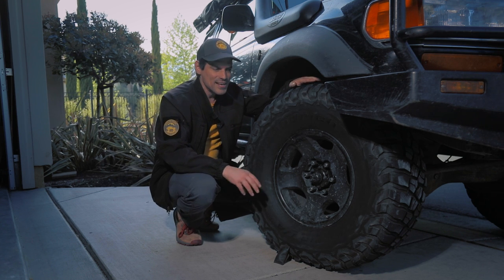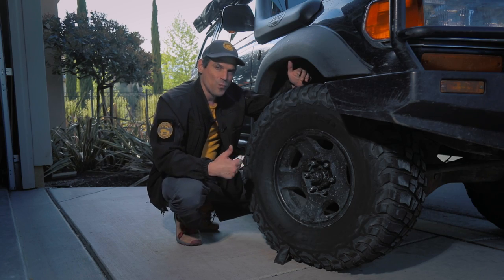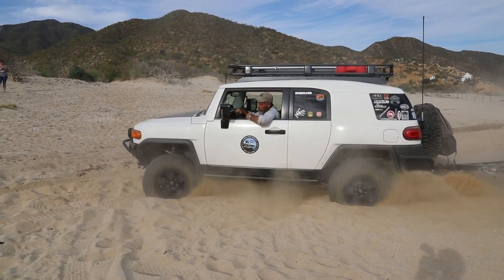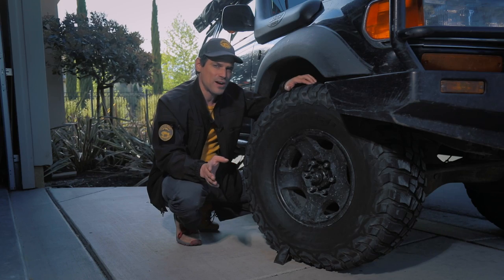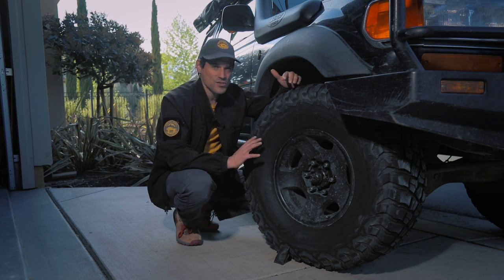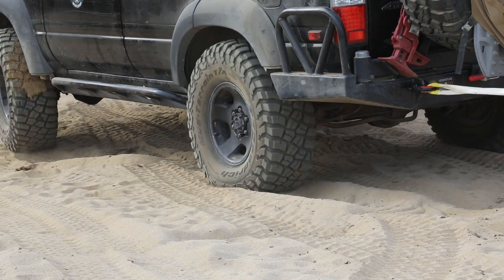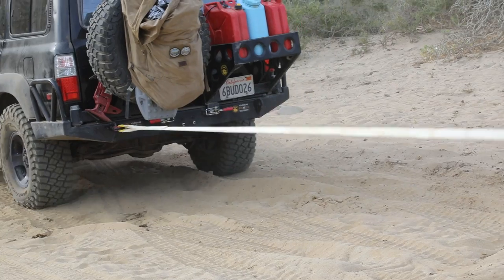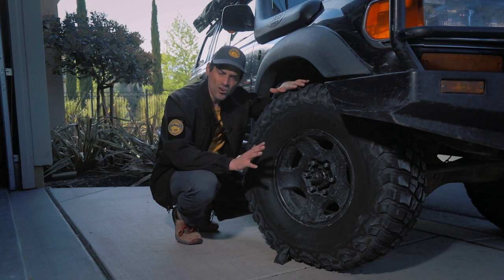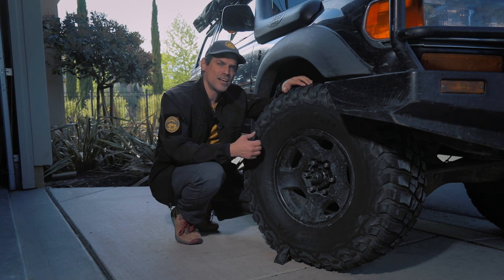Now some guidelines. Go back to the beginning — why are we doing it? Increase the patch that has contact with the ground. It really doesn't matter whether you are in sand or on rock; you're just trying to increase the contact patch. What I will say is that you really feel a difference between street pressure and, say, 22 PSI in terms of comfort in the cab. You're not as bouncy; you don't feel every little pebble on the trail. So if you just go down to 22 PSI, which is very modest, you're going to have a better ride and you are increasing the contact patch slightly. If you're just on a gravel road and not doing a lot of technical off-roading, come down to 22 PSI — you're going to soften the ride, increase your contact patch, and get better performance.